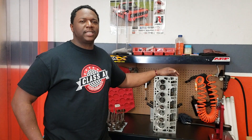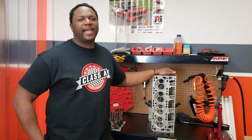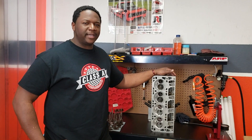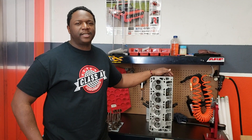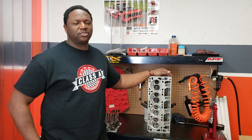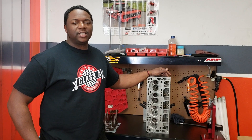The cathedral port family is a really good cylinder head to run on the street. The LS3 head is a really good head to run on the street, but it's a little too big. The reason why you're getting that much CFM — 360 CFM — is because the port is like twice as big, like 260 cc's once we finish.